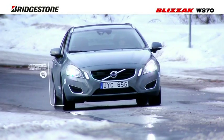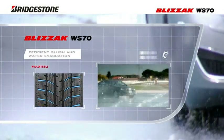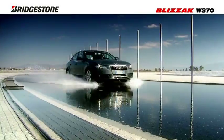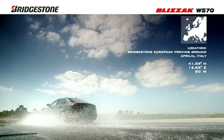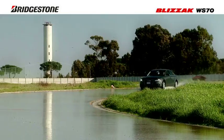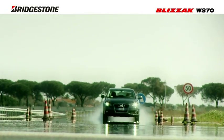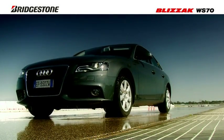The Blizzak WS70's unidirectional tread pattern is also tuned for superior safety and performance in slush and rain. High-volume transversal grooves evacuate water and slush from the central tread region, maintaining maximum road contact and reducing the risk of aquaplaning. The interlock 3D zigzag sipes maintain block stiffness, enhancing grip in both wet and dry conditions, and delivering superior cornering force, acceleration, and braking.